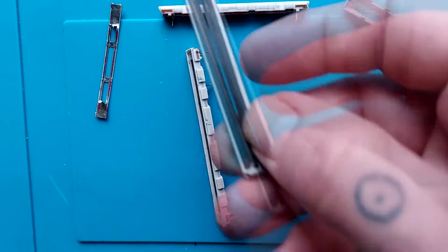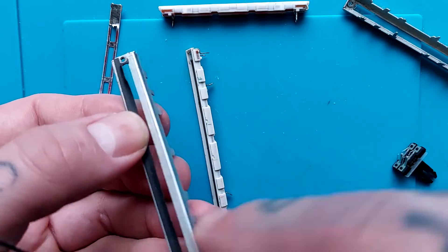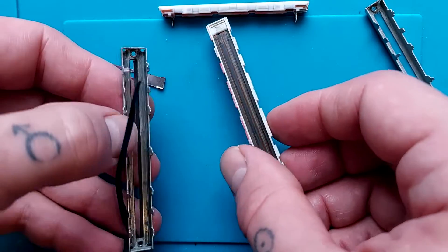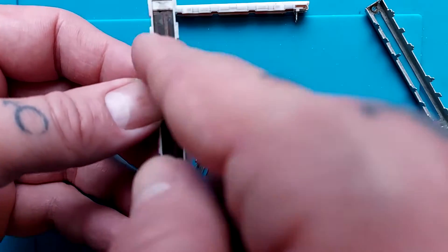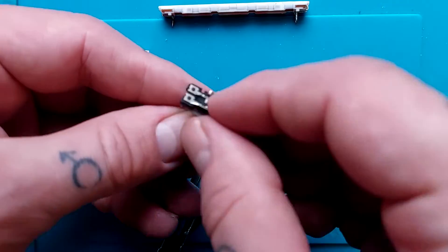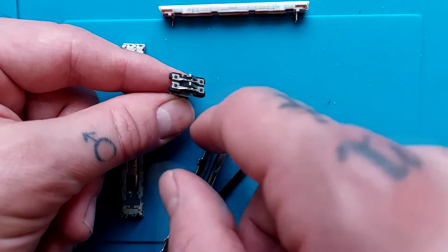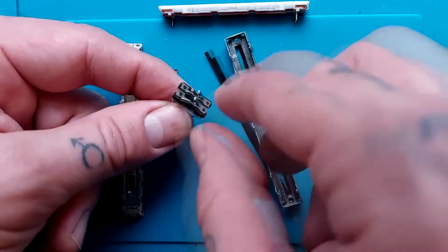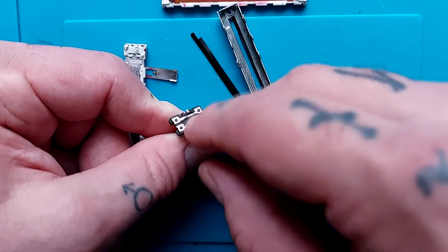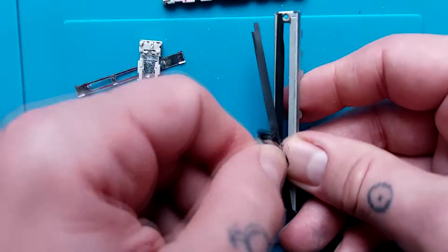Ways that these can fail — you can see the aperture in these. This one's got a kind of rubber protective cover, but a lot of them are open like this. If left in a dusty or smoky environment, or someone spills a drink, all that dirt is going to get in there. That's why you might pry it open to clean it. Dirt and dust can accumulate on the little brushes, but sometimes if liquid and dirt sits long enough the brushes become brittle and actually snap off.